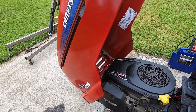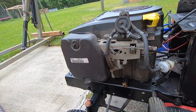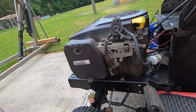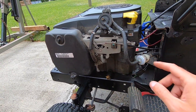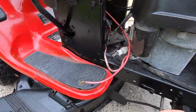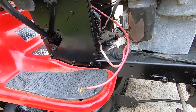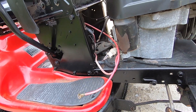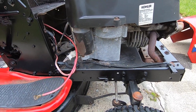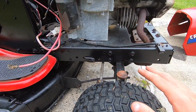This hood doesn't hold very well and I don't want it to break, so let me take the hood off and we'll talk about it a little bit more. Alright guys, this was a pretty cut and dry swap for the most part, besides the PTO differences on the motor. It was just having the fuel line disconnected and the throttle linkage on this side. The throttle cable was still the right length and worked out — just needed to be adjusted. On this side it was just disconnecting the hot lead that goes to the starter and the wiring harness. These two wiring harnesses were the same because they both came off from basically identical tractors, just different engines. The bolt holes lined up and everything for the engine to mount — just four bolts on the bottom — and the big difference was the PTO.